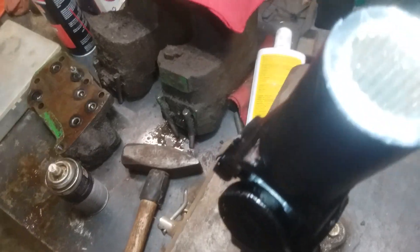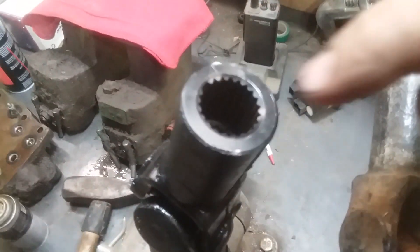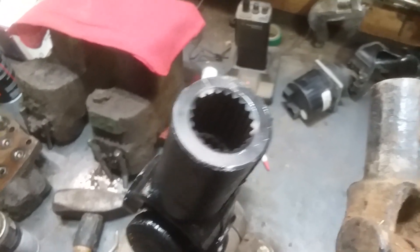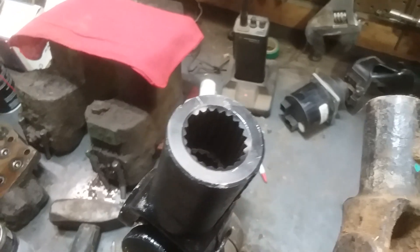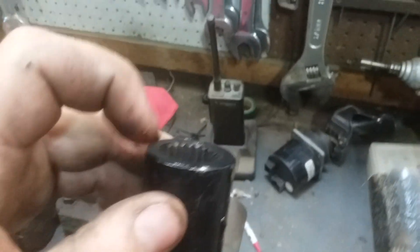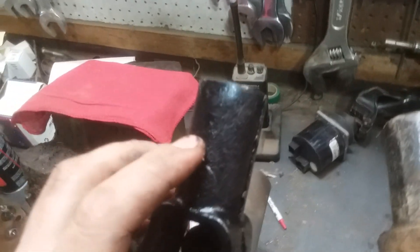Whereas the older 700s and 800s, as I recall, had an O-ring in the top here that would stop water from going into your U-joint or into your slip yoke. Granted, you still had grease coming out this end when you greased them — they have a grease zerk on it — but there's nothing to stop water and snow from getting in here except for grease. So grease it, grease it, grease it.